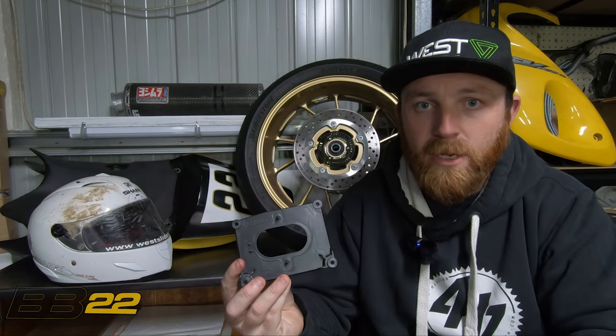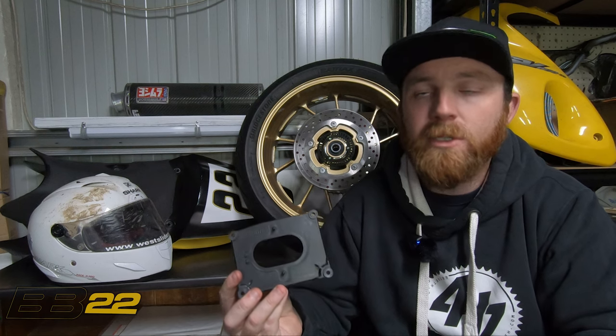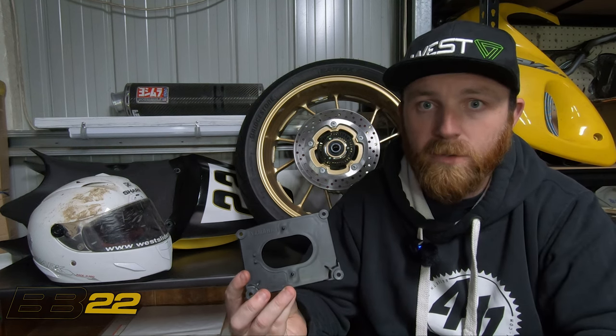With the new bikes it really doesn't change much at all. For the R7, removing the snorkel is not going to net you extra power — it's actually going to reduce your top-end power. However, it is going to move the power around your rev range to give you more mid-range power at the 5,500 RPM mark, which is where most riders are going to ride the bike on the road.